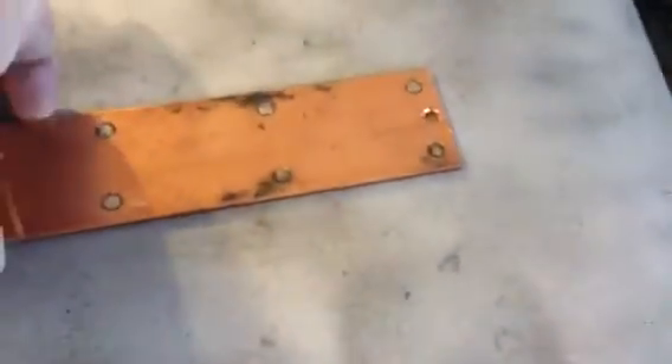You can see there's a little bit of rust here on the door. They make patch panels, but nothing's plug and play — you have to cut it, fit it, and make sure it all fits in there correctly. On the other side of the door, I've got some rust along the bottom. What you do is cut this out and TIG weld it in behind so you don't get a blowout. You put these copper backing pieces behind your magnets and behind your weld so that you won't get blowouts.